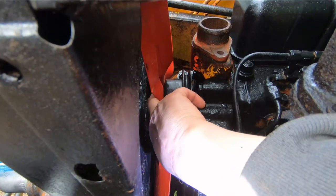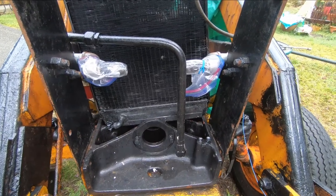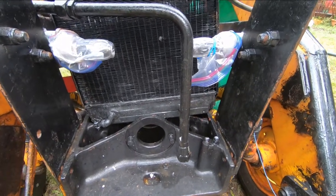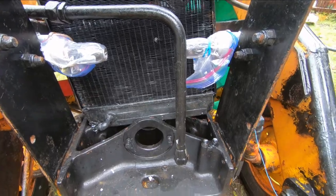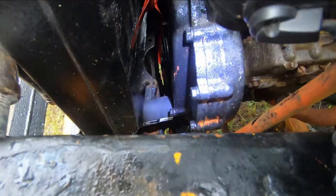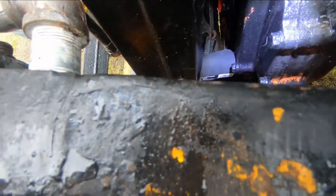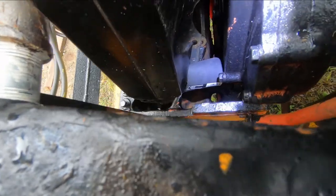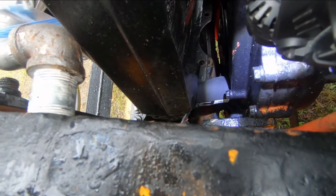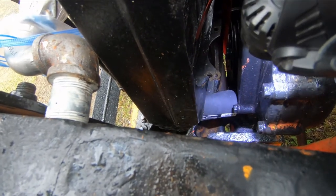What you have to do is put the fan in with the radiator, slide it down, and then put your bolts in later. I had the radiator in there and now I'm lifting it up a little bit. I'll try and get that bottom hose on. I lifted the rad as high as I could get it and that lower hose — I measured it as three inches, bottomed out on both sides — so I cut it about two and three quarter inches long.